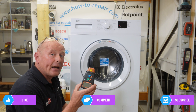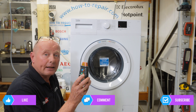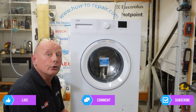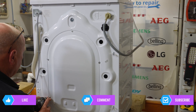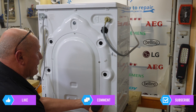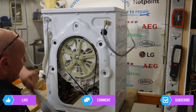These tachometers are very cheap now — not an expensive item. I'll put a link in the description below; you can pick these electronic digital tachometers up for around 10 to 15 pounds, and they're a very useful item to have in your toolbox if you're repairing machines. The first thing you need to do is make sure the machine is unplugged from the power supply, and then we're going to remove the back cover to give you access to the pulley wheel and the belt.